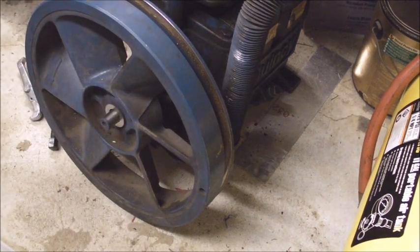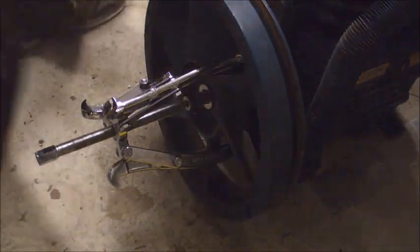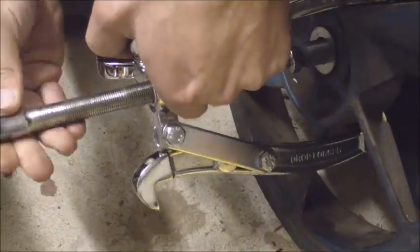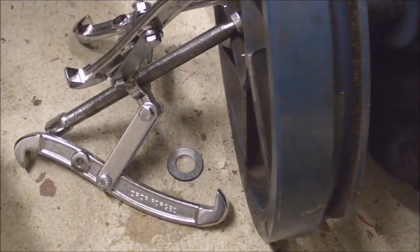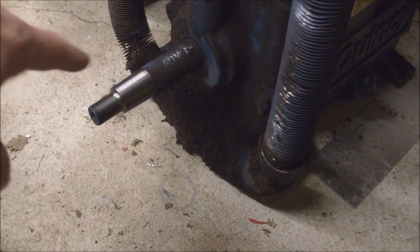I'll put these bolts in the bin. Let's see if I can get this flywheel off — I may have to use a puller. Got a puller on it. She's free! You can tell that was on tight. That's why it's got a taper — the moment it broke free it just popped right off. Now I've got the flywheel off. It's smooth all the way around.